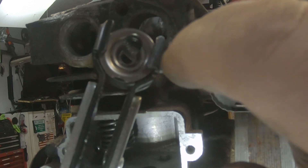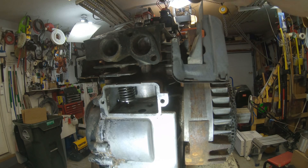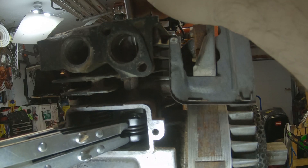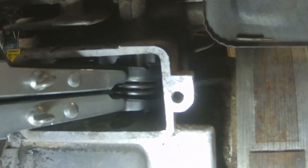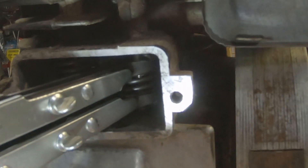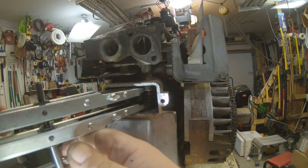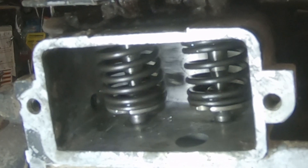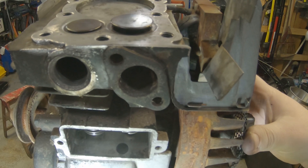Then do the same thing with your intake valve — make sure this open part is in the back, it just makes it easier to finagle that in there. I like to turn it so the other valve is open, that way your tappet down here at the bottom is as low as possible. Drop it down through there, kind of lift it up in the back, push it down the front, then loosen your tool up and you should be good to go. The spring should be squared up on that keeper, and our valves are opening and closing the way they're supposed to.